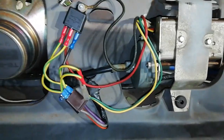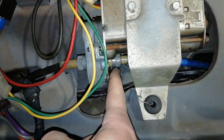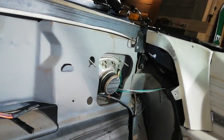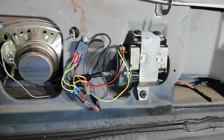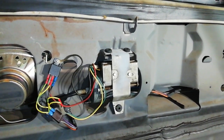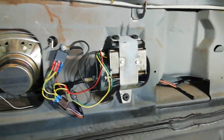Of course, you also have a cable like that on the other side — it's the blue one, which is fixed here, going through a hole into the trunk, underneath the back where the roof is sitting, up to the gear. Same as on the passenger side. So it's the blue one for the driver side and the black one for the passenger side. I think I will replace them both, because it's pretty old so the other one will probably snap in a short time — it's better to do them both.